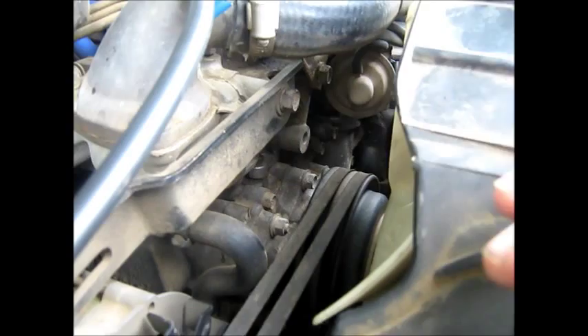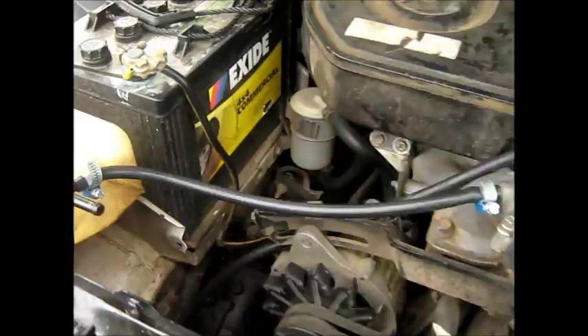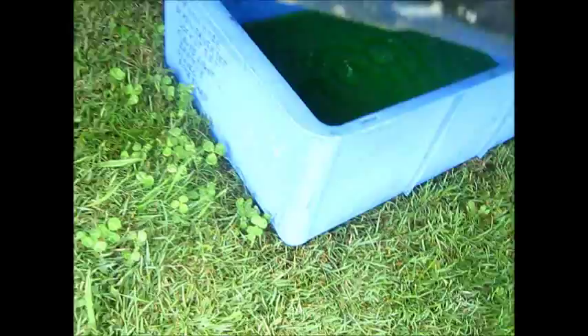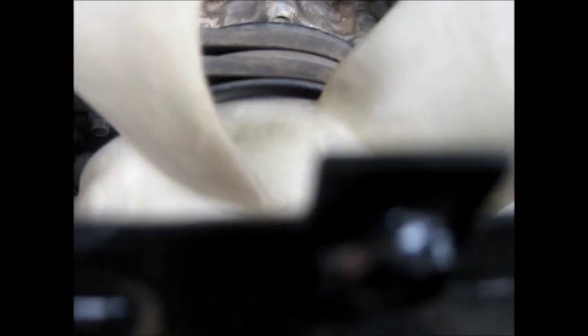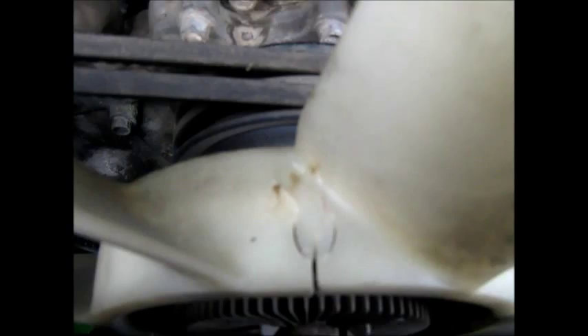That's the water pump there on the Ford Maverick / Nissan Patrol. We've just emptied the coolant, took the bottom hose off the radiator — put a tub underneath because the coolant will kill your grass. Now we're in the process of taking the fan off. Check your fan because this one of mine has had it — you can see the cracks in it. There's a big crack there and another one there. She's as old as the car — about 22 years old. I'll do the pump today and get a new fan during the week.